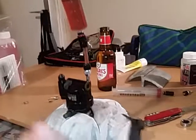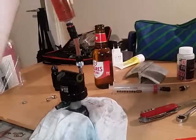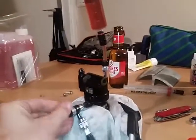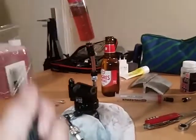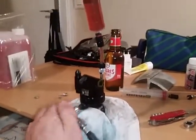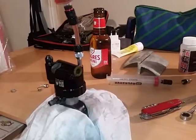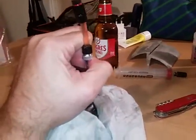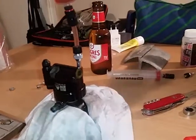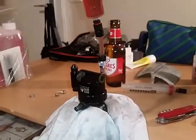Repeat these steps a few times — 3 to 5 is enough. I've already done it twice here. Then put it back to the initial position: press it down, push the IFP to the maximum until the shapeshifter comes up, then press it down. And it's ready to be fitted.